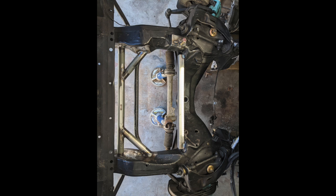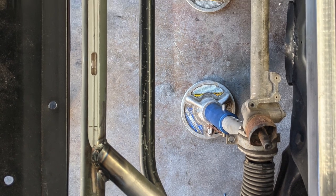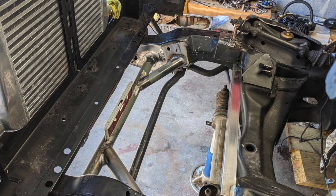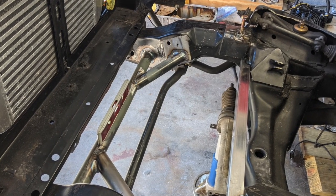In this picture, you'll see there is a welded-in K-member with a level on top of it, and the Mark II rack is still sitting there with a welded brace that goes across right where the motor mounts are. At this point there really is no turning back, because that K-brace is welded in directly where the old steering box actually bolts into. So now we're trying to get into fitting the pan.